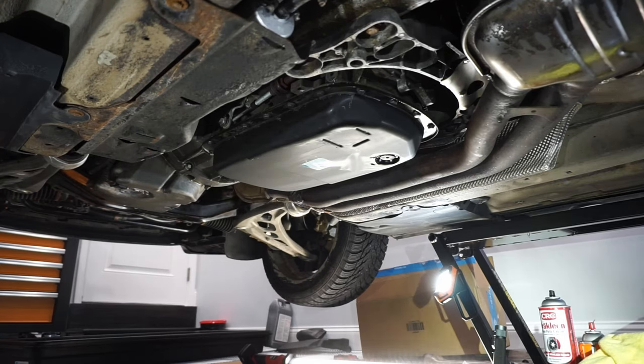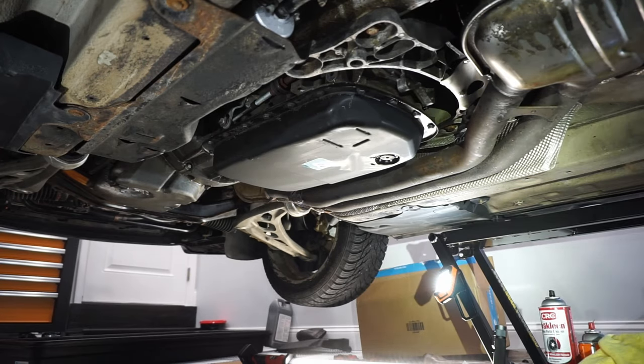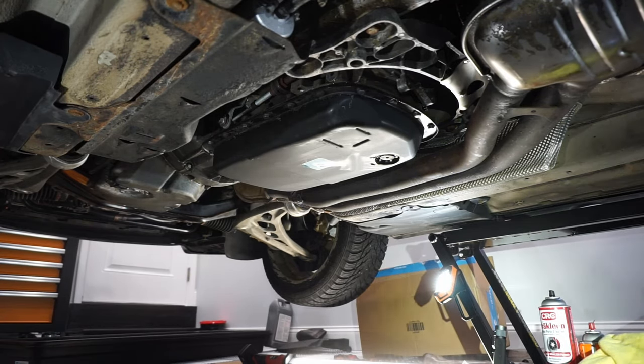That being said, the symptoms I'm facing right now are, when I put the key in the car and go to start it, it does not allow me to start the vehicle. What happens is I am stuck in what shows as S. When it's in S mode, the vehicle seems to think that it is in gear, which is thus not allowing me to start the car. So I did read the codes. The transmission module said that there was a failure in the transmission switch. This seems to be the culprit.